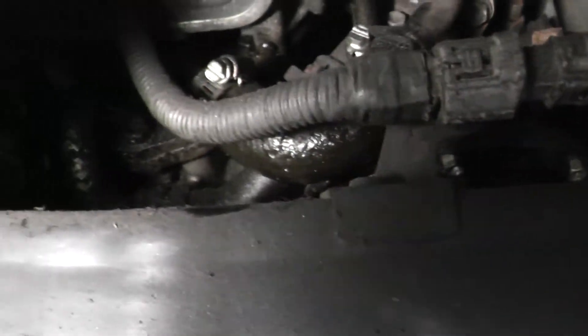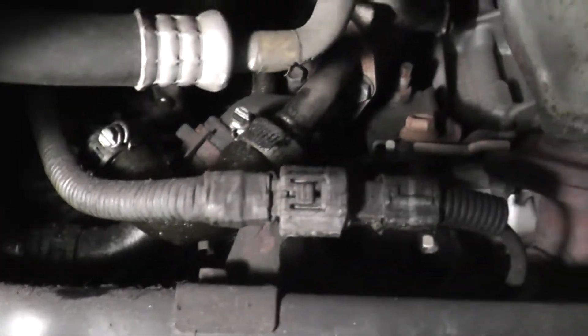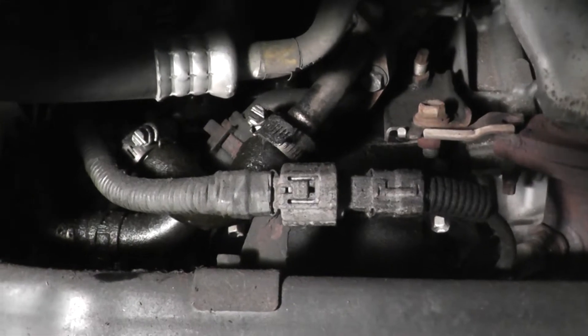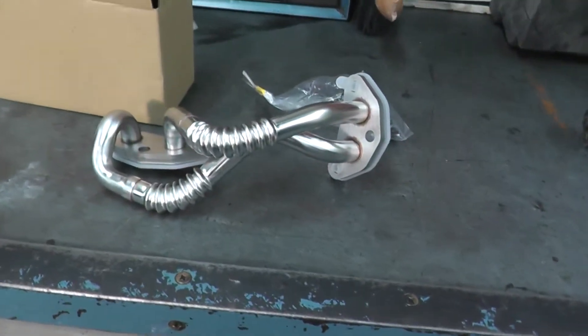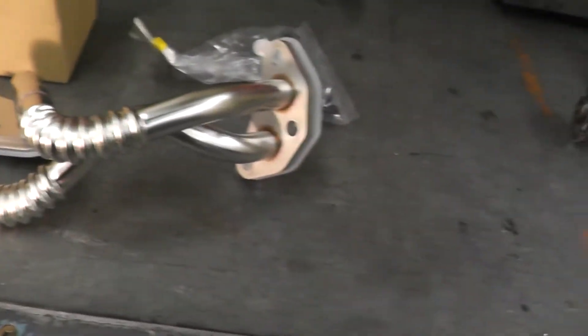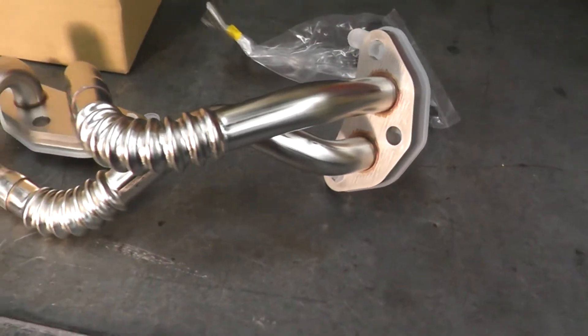You can see that swelled up one with oil on it. It's mostly the front one that leaks. Toyota has made a replacement part — it's no longer rubber hoses. Here is the dealer's part number — you can pause and look at it. This is what you get: the gaskets and the new cooler lines, which are metal now, so they hopefully won't burst again.